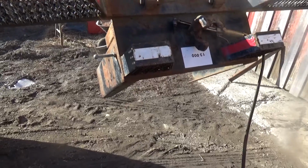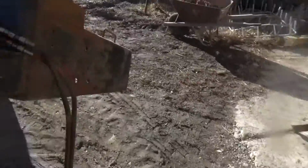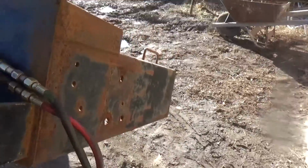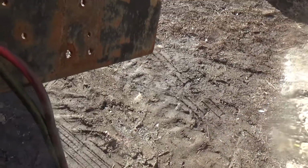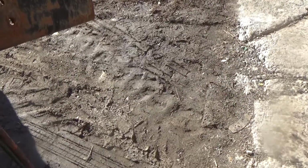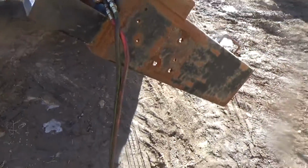He just cut it off a truck because he didn't want to see somebody just junk it and not do anything with it. So it's going to have this nice step here to get up on the back of the low bed, or the flatbed. So the next task is taking the old hot wrench, and we need to cut these welds here. I'm going to leave this plate. I'm going to try burn these welds off and separate this. I mean, I could add this on to the frame I have, but then you have to angle cut it, because you can't weld these frames straight up and down. You're not supposed to, and I don't really want it any longer right now. Again, that's all stuff we can change in the future if we so choose to.